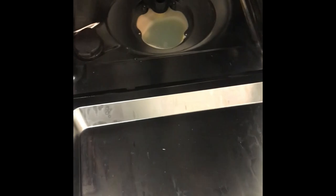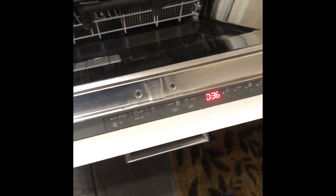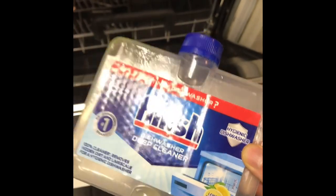Pop your filters back on, take the opportunity to top up your salt and rinse aid, and then give it a whirl. It's all on and ready to go. I'd recommend once you're confident it's working, give it a run through some dishwasher cleaner. You can hear through the sink it's just draining a little bit now. You shouldn't hear the same error beeps as before and it should just execute the program as per usual.